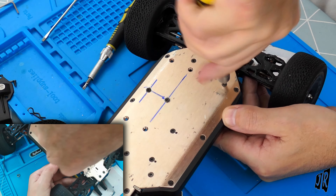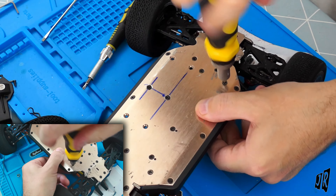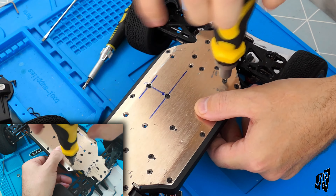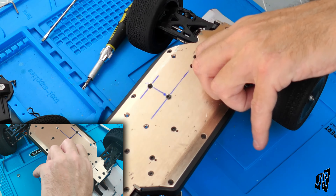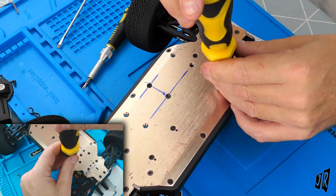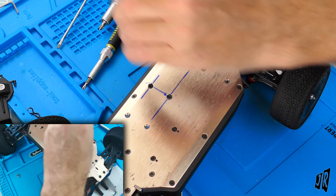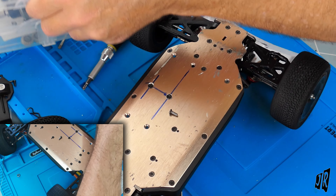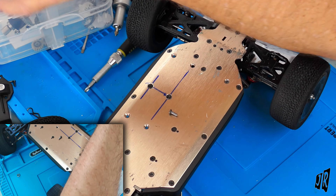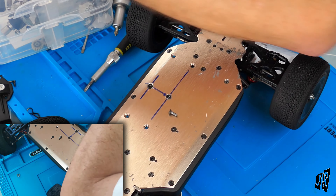You need to make sure - do I have to take that off again? No I don't, because I don't have the centre plate now, so that's why that was easier to get out. But the bearing has to be in the U part of that so that you can get the screws back in. If you wonder why I always undo the steering on the bottom rather than the top, it's because when you undo it at the top this bearing keeps on falling out. I lost one the other day.